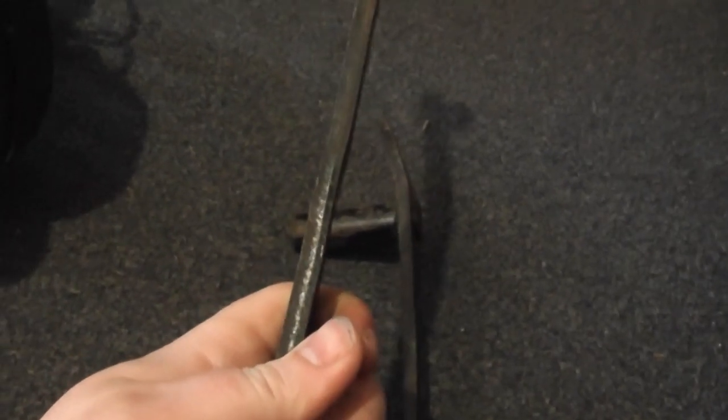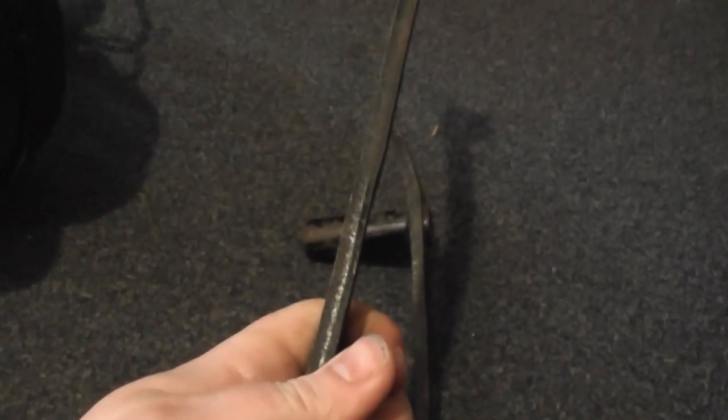So what you need to do with the clutch pedal is there is a big kink in it. I'll show a picture of both the pedals as they sit in the car without alteration. And there's a big kink in the clutch pedal, and all you need to do is straighten it out, as I've done here, or had done rather, because I got an engineer to do it properly for me in a vise, because it's very thick steel, although it isn't hardened, so you could heat this up with a blowtorch if you had one, which sadly I don't.